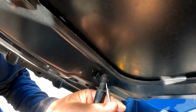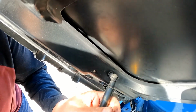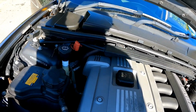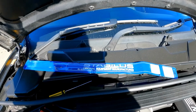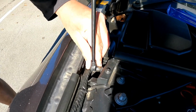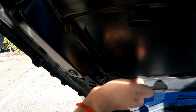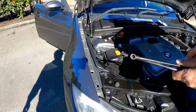These clips are a bit hard to see in the sun, but you can see there's a little groove right here. So we're going to push that one outwards, and sometimes you can slip, so you got to be careful. There you go. That's your old one out. Leave it there. And chuck that there, that's the Stabilus. Then what you're going to do is the same thing. Push it in until it clicks, and then push the bonnet a bit higher until it clicks. There you go.